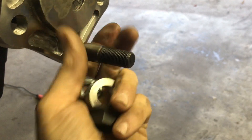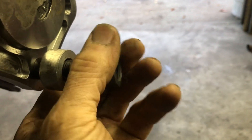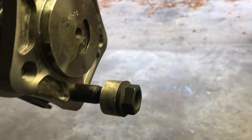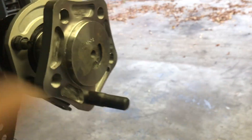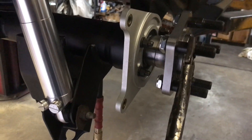This stud has a shoulder that's going to get threaded onto that — it'll bottom out on the shoulder in there, and then it's got a locking nylon nut that goes on the inside to keep it from backing off when you try loosening the wheel with an impact gun. So you hold that, tighten it, then the wheel goes on, the spacer goes on, and then the 5/8 nut goes on. You can get fancy aluminum nuts or titanium, whatever you want. Studs are all on, locking nuts are on — hold it with the vise grips and tighten these up, they're 15/16ths. Lock all them in place and that's done.